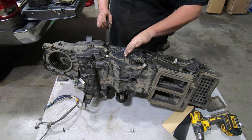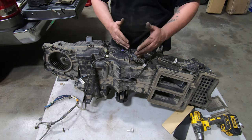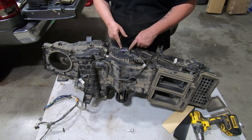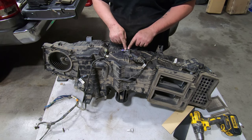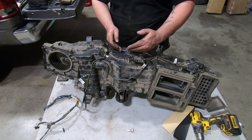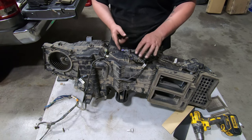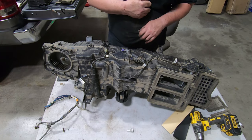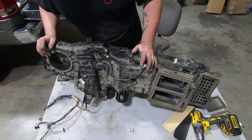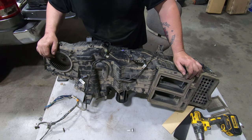With this rod mechanism, you want to make sure both doors are traveling to their fullest extent — that this one hits its stop and that one hits its stop, because you have a little bit of movement. What I did was shut both all the way, pushed on them a little bit to make sure they were under slight tension, then tightened it down. Now they're in sync and good to go. We're going to replace the rest of the weather stripping, pick up some new weather stripping, and we're good.